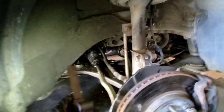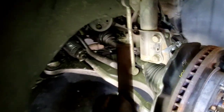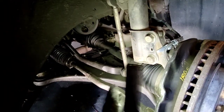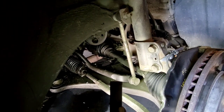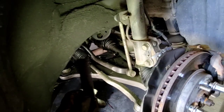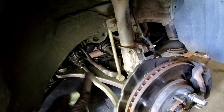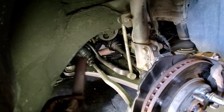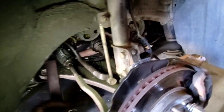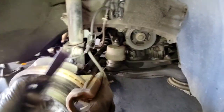It has a bad vibration. She's been driving for a while. She was reluctant about getting it repaired. But the CV axle is the culprit here. As you drive under load conditions, when you go to accelerate, it trembles and shakes, and it's very violent now. I've done some vehicles that were pretty bad, and customers typically get taken care of early on, but she's been driving like this for a few weeks.